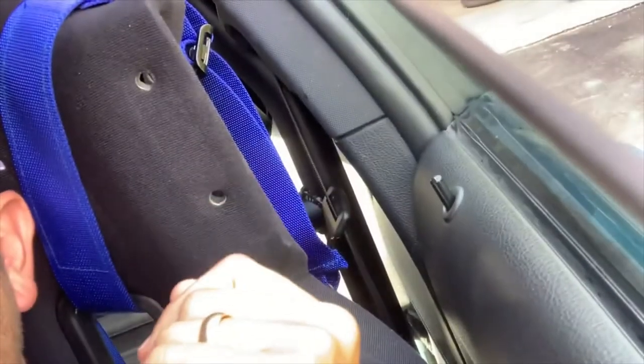I didn't do sliders on the seats. I wanted the seats configured to my height and liking. For the passenger seat I went with the large size and it's set a little more rearward so an instructor with a different body type can fit in there comfortably. I've also retained the three-point seat belt since I drive the car on the street occasionally, and Mitch was able to attach the seat belt to the seat bracket itself.